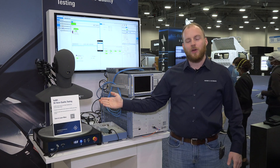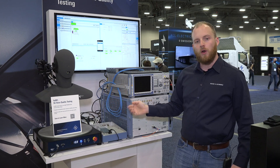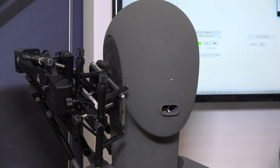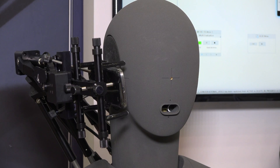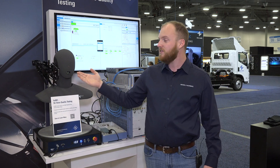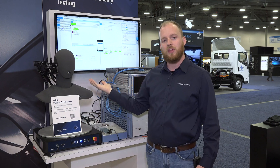Over next to our test equipment we have the Head Acoustics hardware, the HHP4. This is an animatronic head that can be used to do analog audio quality analysis using the high precision speaker in the mouth as well as calibrated microphones in either ear. We have a handling device that we can use to position the phone and change it relative to the mouth and ears.